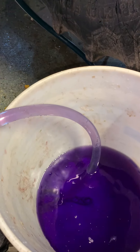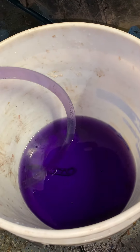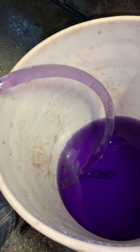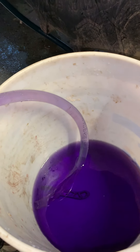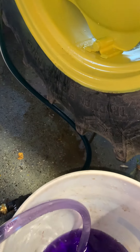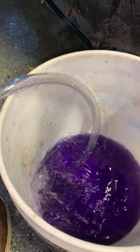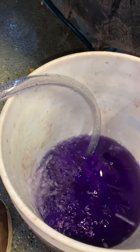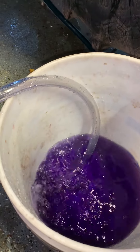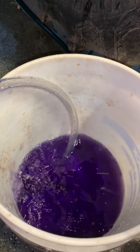There we go, we'll suck some more out of there. I'm going to show you how you can tell how much you've got. First we're gonna let the air out — it's gonna back out there. When pumping up a tire with liquid, you put in the liquid and it compresses the air in the tire. You've got to let that compressed air out so you have less air resistance as you're pumping liquid into the tire.